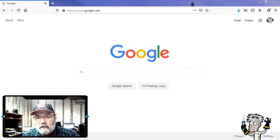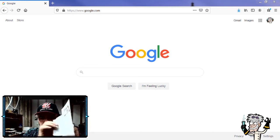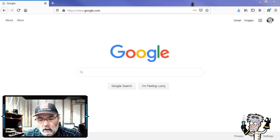Okay guys, so according to the Hiseeu instruction booklet, they give you a little indication here on how to hook up the camera. Of course, I've already showed you that. And then it says open the CD and install device manager tool, and then open the tool, search for the IP of the camera, and then click web browse or input the IP address into the web browser and log in and select the video stream for view. The default username is admin with no password. So I'm guessing that's the IPC tool.